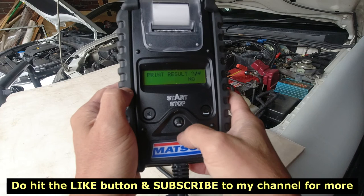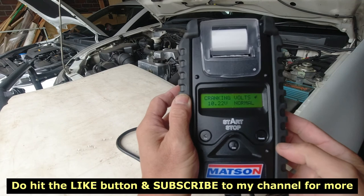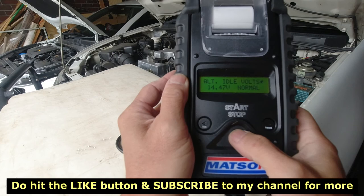Now I'll proceed to do a system test. I'll start doing the system test. Turn off loads and start engine. It's detected cranking volts 10.22. Rate that as normal. Press enter. All loads are off. Idle voltage is normal. Now it wants me to turn on loads.